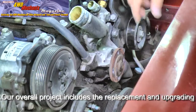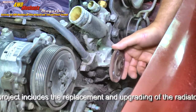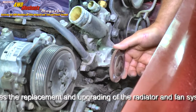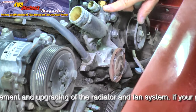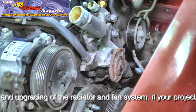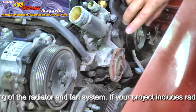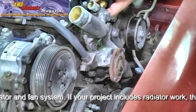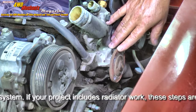We're going to take a few minutes here and change out the water pump. This water pump has been on this engine for 140,000 miles. We'll go ahead and change the pump since we have access to it. If we needed to change the thermostat — which has been done recently — this is the thermostat housing, and the thermostat is inside. It's accessed very readily with the removal of those bolts. In any case, let's go ahead and replace the water pump.